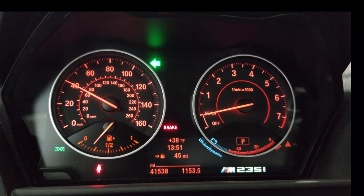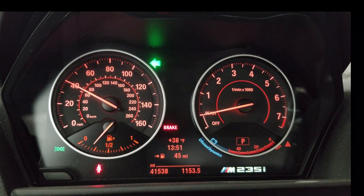At 40 you can turn on or off automatic fault code deletion if they pop up. I'm paranoid, so I don't want the JB4 to automatically delete any fault codes — leaving that off. And 50 is to change the dash mode from standard to metric: zero is standard, and at 1,000 RPMs it'd be metric.